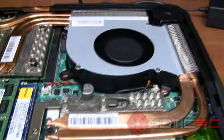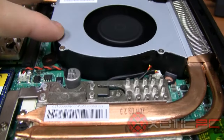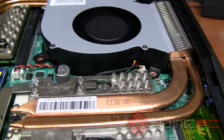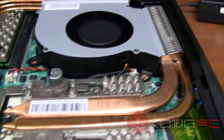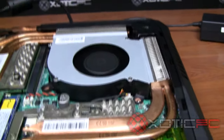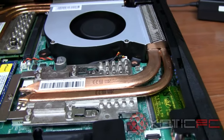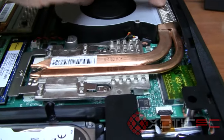The fan, in addition, is also really easy to remove. So it's something that, because of that, on this system or really any system, we suggest every 3 to 6 months, depending on whether or not you have pets that shed. You want to crack this guy open, take out the fan, clean out the fan, clean out your thermal heat sinks with compressed air. A lot of times people will look through there and say, well, there's not really any dust that I can see at all.